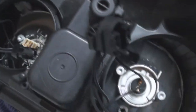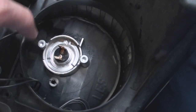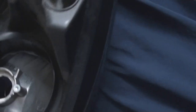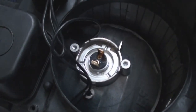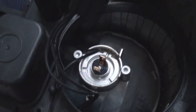I'm doing this on a headlight that's out of the car just to make it easy for you so you can see quite clearly what you've got to do. There's a little cage that sits on top of this bulb — you just undo the cage, take it off, take out your old bulb and get your nice new Night Breaker. Put it in so it lines up correctly, fit the cage back on top — nice and simple. Then all you have to do is connect the plug onto the top of the bulb. And that's it, it's done. Put your rubber cover back on.